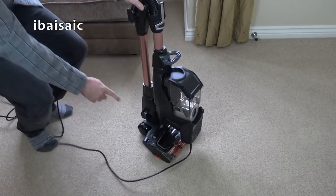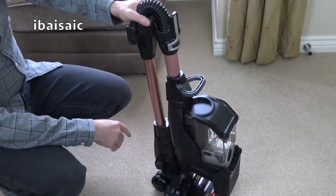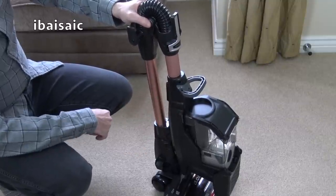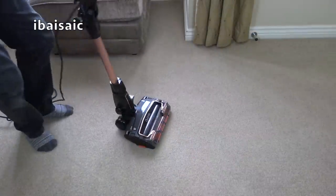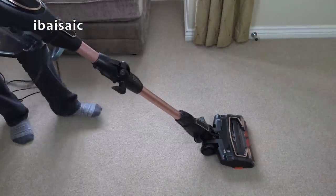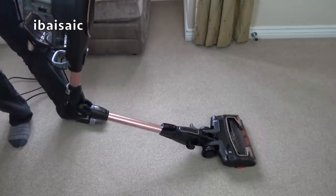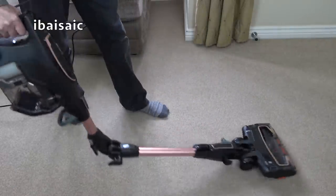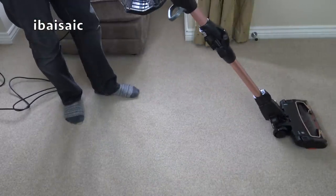There is space on here to store the cord — you've got a fixed lower hook at the bottom and a swivel hook at the top. That's easier than having to take it off the wand and hook it over the bottom hook as you did with previous versions. The Flexology works the other way too — as you're cleaning, if you want to reach under low furniture, you simply press the button at the back and flex the wand in half, which enables you to clean under furniture without having to bend down, and then it just locks back into position when you're ready to clean the carpets.